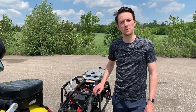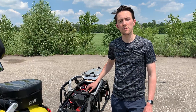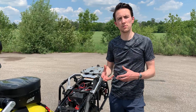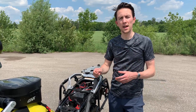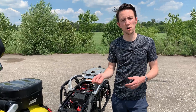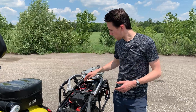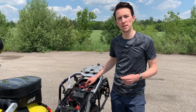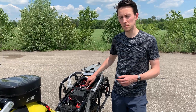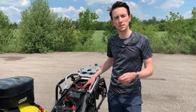So in order to achieve that on my bike, I use an auxiliary fuse box. I have this set up with a relay, and to summarize for anyone that doesn't understand what an auxiliary fuse box does: I have power that only gets delivered to this fuse box when the bike is on, and it's the relay that triggers that. Then I attach any of my accessories, including the auxiliary lights, to this auxiliary fuse box.